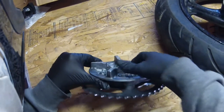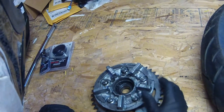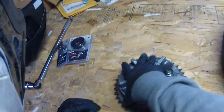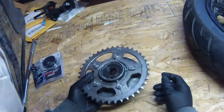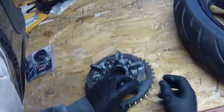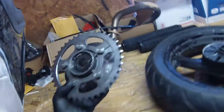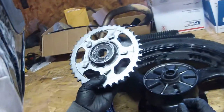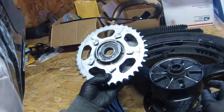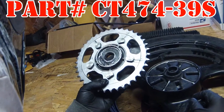Make sure that whenever you put these in, you Loctite them and snug them down real tight. Before you can put it on, put your sprocket on, slip your bolts through, put your nuts on, Loctite them, and snug them all down. That's your rear buildup. This sprocket is the 39-tooth, 520-pitch GS 500 pattern sprocket — part number up here.